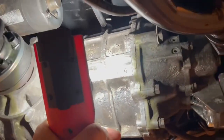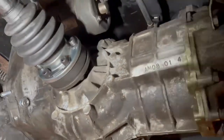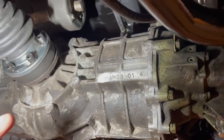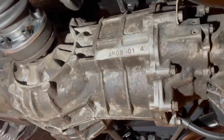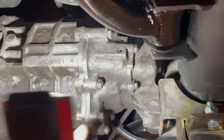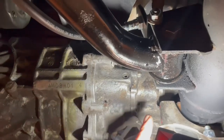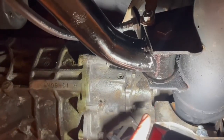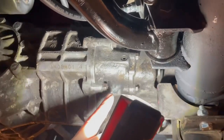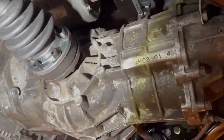You can get a transmission with a longer travel ratio, but for this application it's perfect. You get the RPM dropped about 500 going 100 km/h and it's lighter. The shifting is also better — on Type 2 you have two different stages of hockey sticks inside the transmission housing before you get to the shifter, but on Type 1 you only have one step, so it's easier to get a more firm shift.